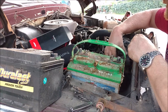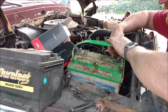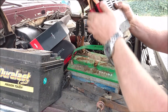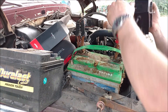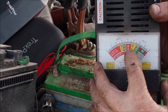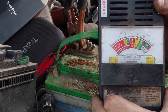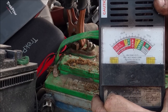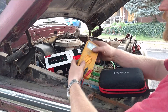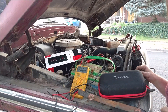This one has polarity on a different side — let's see if the leads reach. Now, this is a battery load tester — not the most precise instrument in the world, but it'll give me a good idea of the condition. It looks like this battery is sitting at nine volts, already in the bad zone before I even put a load on it. This puts about a hundred amp load on the battery, and it drops off to absolutely nothing — this battery has zero charge in it. Let me grab a multimeter so you can see what the voltage is doing — it's sitting at roughly nine volts.